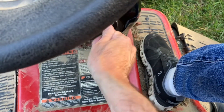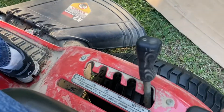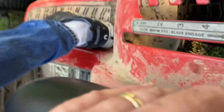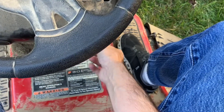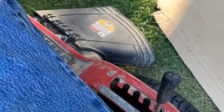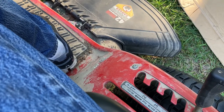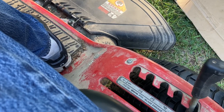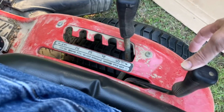It can cause nothing — nothing will crank. I'm going to hold back on the handle and crank it. You can crank it because you have to make a switch. The problem is the blade has to be disengaged to go in reverse, so that switch is the disengagement. In order for this lawn mower to crank, it has to think the blade's disengaged. That's why you've got to hold back on it to get it to crank, then you can let off of it.